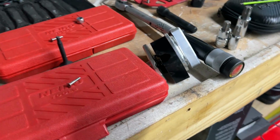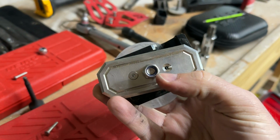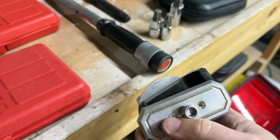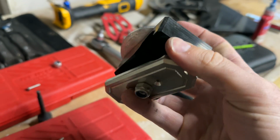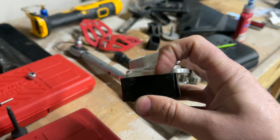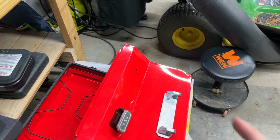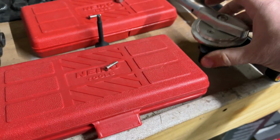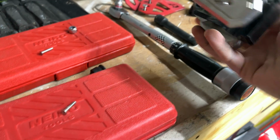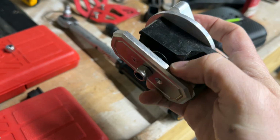In order to get these onto the Jesse boxes, you're going to do a couple things. You're going to remove this locking nut, which shouldn't be tightened down because it's just staged there for you. You don't have to remove this. I think it's a 2.5 millimeter hex. But you do have to remove this 5 mil and these 2.5s on the back side in order to separate the silver piece from the black piece there. Once you've done that, you can put it through and then hold on to this 5 mil with a hex of some sort. Hold on to here while you screw the bolt that starts over here and goes straight through to there, and that'll hold it on.